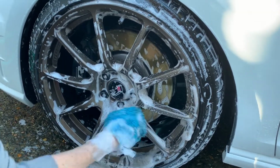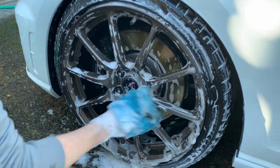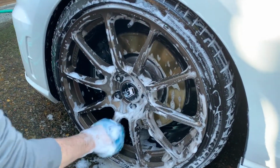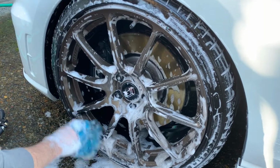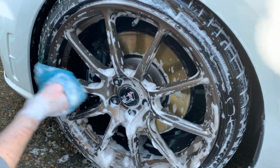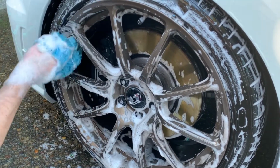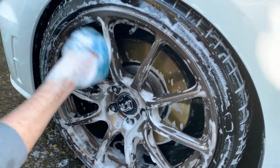If you got the wheels off the car for the winter, or you're running a winter or summer wheel set, it's a great idea to wash those up when you put them away, and even put a coat of wax on the inside of the barrels if they are a painted surface. A little tip there helps cleaning them up that much easier.